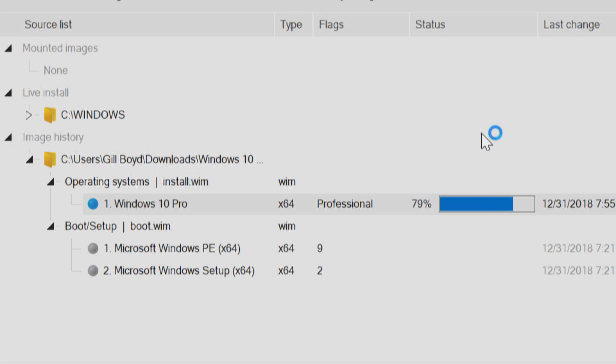My suggestion when buying thumb drives: get more than one. You'll need one to clone, image, or backup your machine, and one for Windows installation media. Because of the specificity of what we're doing, be sure to label it so you don't mess it up in case you need a clean install again — or if a friend needs help. This is also the same size media used for password reset disks, and we have a video about that on BuilderBuy's YouTube. Even though this is specifically for the Gigabyte X399 Aorus Extreme with an upgraded Wi-Fi card, this should be applicable to anyone on the X399 chipset with onboard Wi-Fi. Slipstreaming the drivers is the easy way around it.